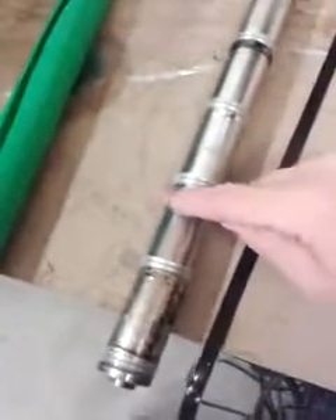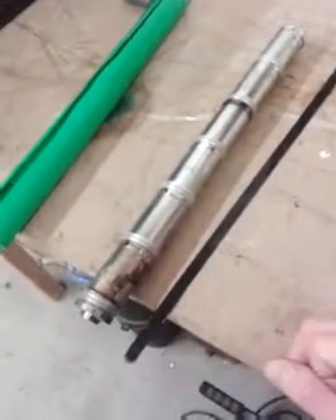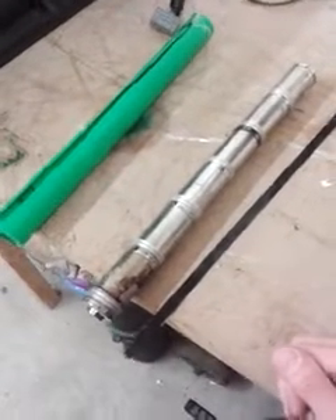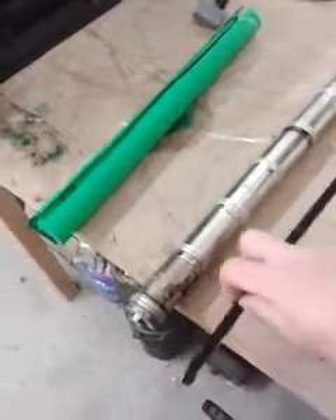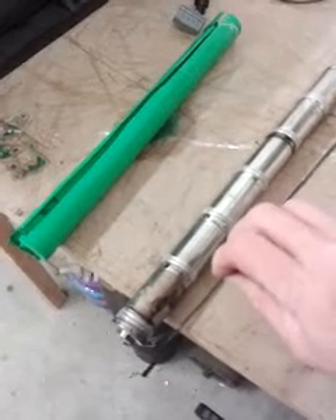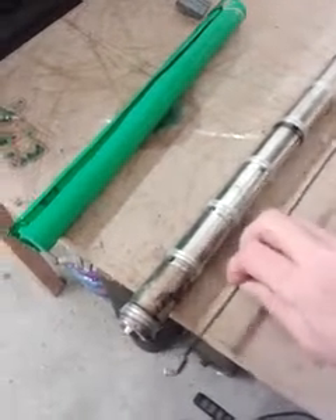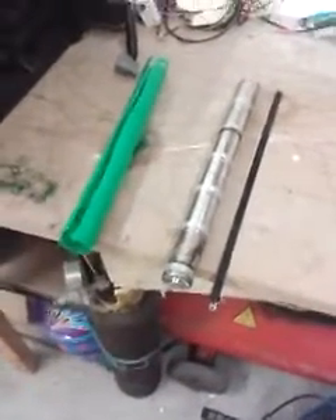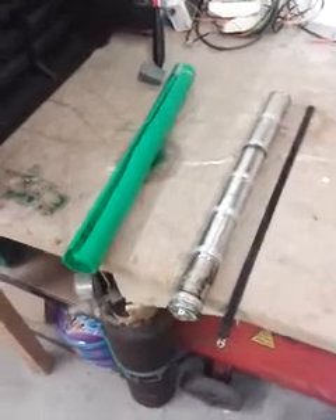That stick is going to have to be replaced, but I'm also going to take all the other sticks out, cycle them, and check them for capacity while putting in another closely matched stick. Cell failures can happen, and the high voltage short circuit is not an uncommon fault. Electrolyte leakage damaging the PTC strip and causing a voltage path through to the chassis of the car is clearly one of the causes. I hope that helps other people who are looking for these problems.